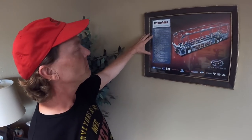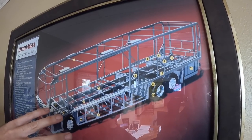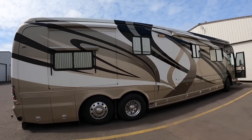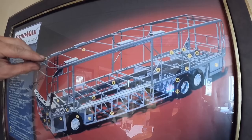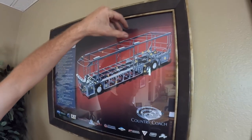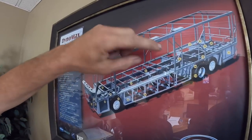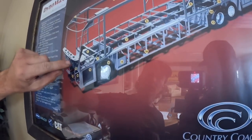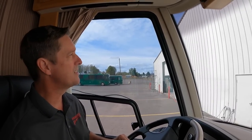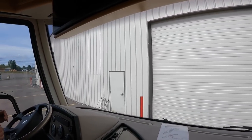It's going to drive amazing. This is everything about the monocoque chassis for the Magna and the Affinity. You see these steel braces that are in here — they're to mount the awnings that are mounted to the roof. You had steel structure in there and a solid plating, like a piece of 3/8-inch plate steel, specially fabricated and welded into the structure, sandwiched in around it. Then you have the wall structure cut out for the slide rooms. This is the chassis that rolled out of the back building back in the day.